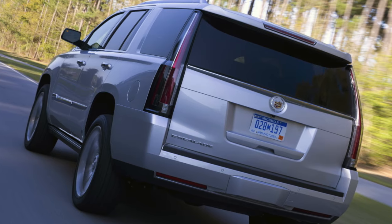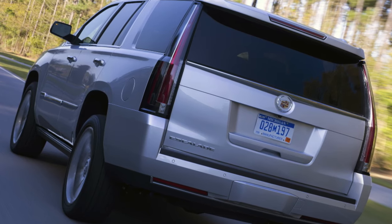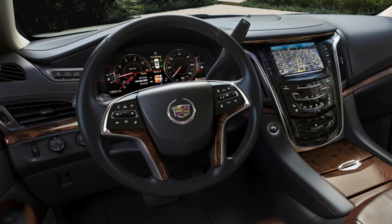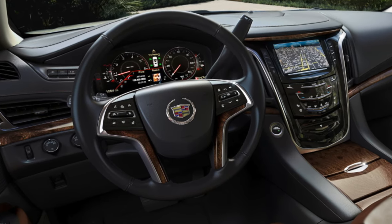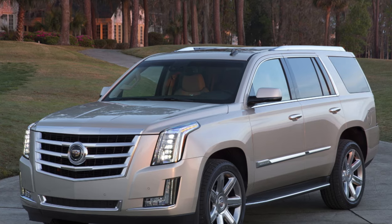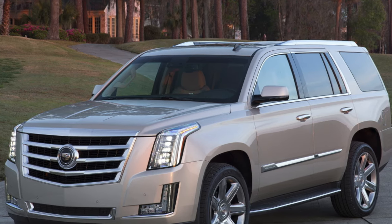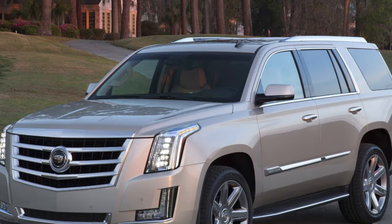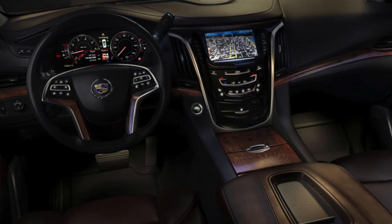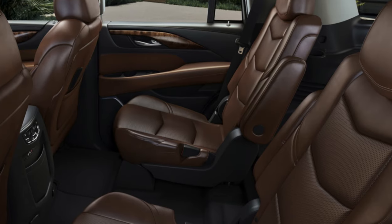This is the weak point of the Escalade. Therefore, when buying a used Escalade, the first thing to do is inspect the doors for corrosion. Omnipresent corrosion also penetrates under the bottom — radiators are left to the mercy of corrosion, the air conditioner heat exchanger begins to leak, and together with the supply pipes, over time the mirrors cease to fold due to failure of the drive electric motor. After just a couple of Russian winters, retractable thresholds stop working.